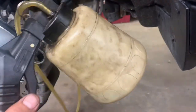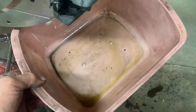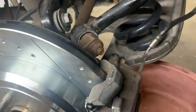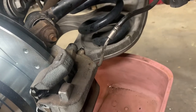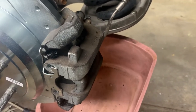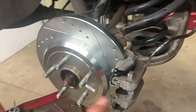There's a little fluid in here. Check if it looks clear compared to how yellow it was dripping before. Now it's coming out pretty clear, so we accomplished a flush. Let it drip a little more to make sure all air is out of the system, then snug up the bleeder and put the rubber cap back on.